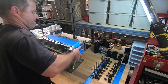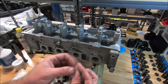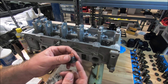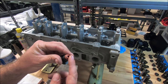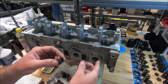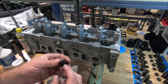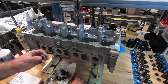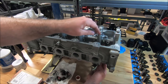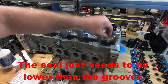Now we can flip the head over. These are the valve stem seals you're going to be using - Felpro SS72891. These come with a little straw-type thing, and that's to protect the seal as it goes over the valve stem. Where the grooves are that keep the keepers on there, you don't want that groove or the end of the valve stem messing up your seal as it goes on. So you put this on the valve stem, that covers up the grooves, and we can put this on there. I like to put some oil inside of it and along the top just to oil them up before I put them on. Now it'll slide right over the top of the valve. You might want to hold the valve in or else it's going to push it down. These don't have to be fully seated right now - you just want to get it down around the grooves and then work our way down.